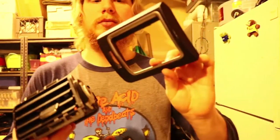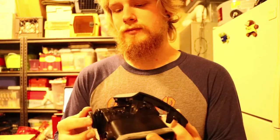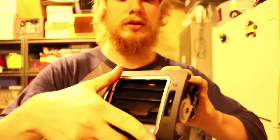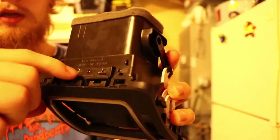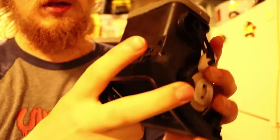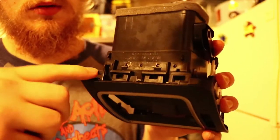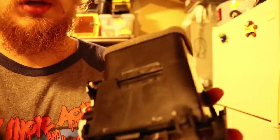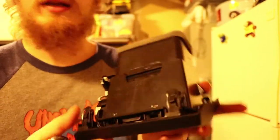I've been doing a little work off camera and was able to separate these. This comes out pretty easily as long as you have several smaller flat head screwdrivers. There are these little clips in here and you're just going to get a flathead over them and pull and push at the same time — do that for all four. The side ones come out super easily, you can just lift them with your finger. I started with the top piece then moved to the bottom.